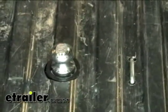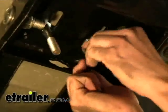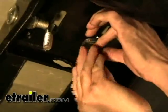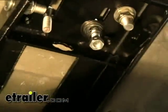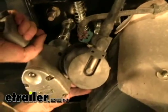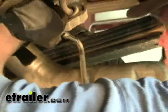Now we'll go back to the bottom of the truck and install the spring and hardware. First we'll install the washer and nut — we'll do that on all four bolts. You want to tighten the nuts down about two threads past. Then we'll put our vapor pump back into place and go ahead and reattach the exhaust to the rubber hangers.